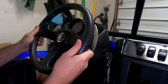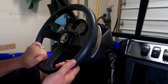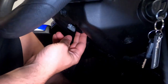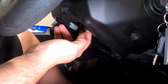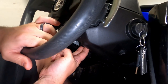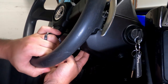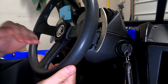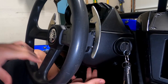Now I'm gonna show you how to adjust the steering wheel. A lot of people know how to do this, but if you're doing it for the first time it's kind of hard to find the lever, and it takes a little bit more strength than you think. The lever is located down on the underside of the steering column — it's a little black lever. Pull it towards you; it only moves a tiny bit. Put some pressure on the lever, then push the steering wheel whichever direction you want to go. When you get it where you want it, just let go of the lever and it's locked in place. It doesn't have to fall into any certain holes, so you can position the steering wheel exactly where you want it.